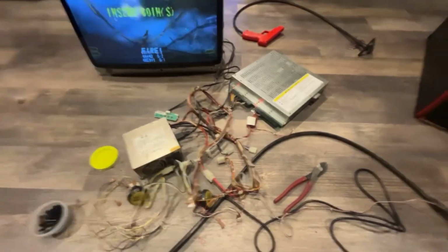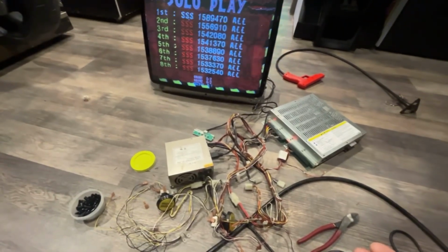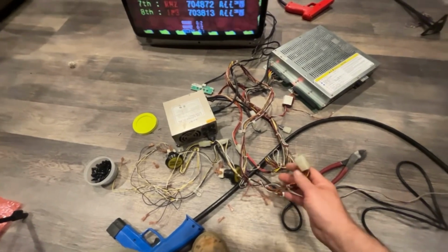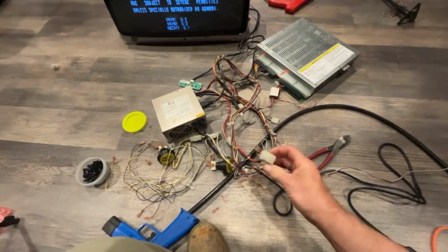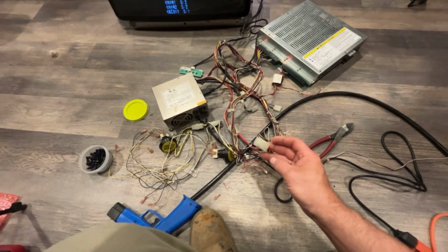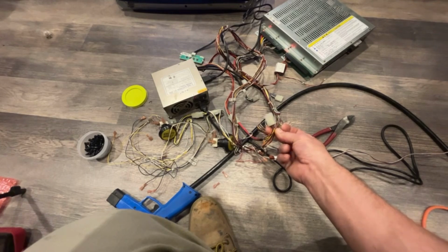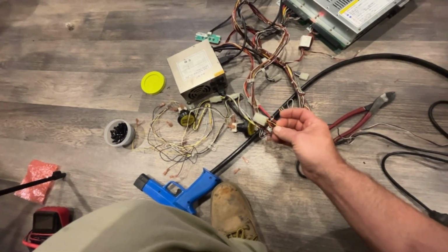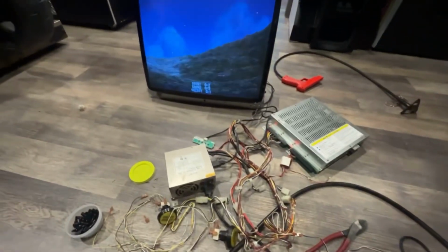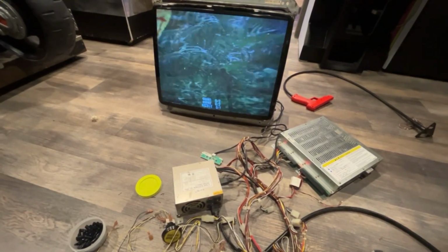What I'm trying to do right now is figure out how to get into the menu of the game so I can do adjustments. I believe I could put it on free play at that point, but I can't do that until I figure out what I need to do, because I don't have the inside cabinet switches. I'm gonna go check the PGA Tour wiring harness to see if I have it and it'll plug into this, because if that's the case, then I can get into the menu. Otherwise I'll have to make a little jumper wire for now and jump from one terminal to the other. But I don't want to do that until I figure out what wire goes where, because I don't really know as of right now. I would assume black is ground, but I probably should not assume that, just in case it's wrong. So let me go look at the wiring harness in PGA Tour and see if I have that switch to get it into the test mode and all that stuff.